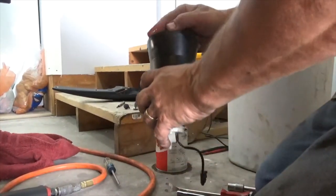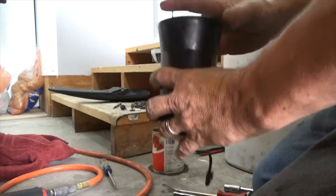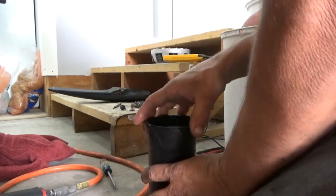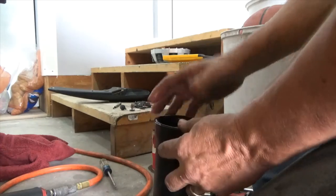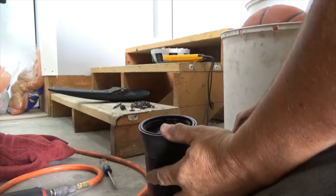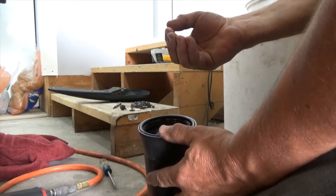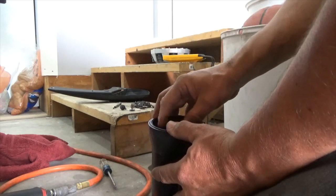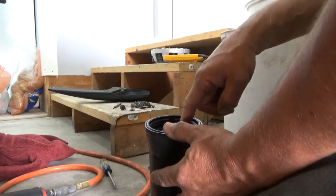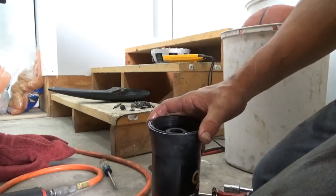Okay, so I'm just gonna use a little of this diesel fuel that I drained out. And then before I put it in there, I've got a can of diesel in the back of the truck, so let me fill that up, and then you don't have to spend as much time. There's a primer bulb on top of the pump. So if you ever run a diesel out of fuel, because it doesn't have a pump in the tank, it can't pull the fuel up, so you have to prime it. One of the ways of doing that is there's a pump on top and you can sit and pump it and pump it until it gets hard, or you fill the filter first and then you pump it and it's a little less work. So let me fill the filter and I'll bring you back.